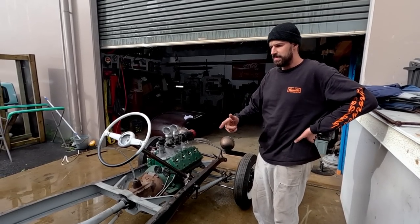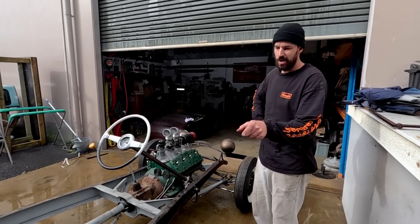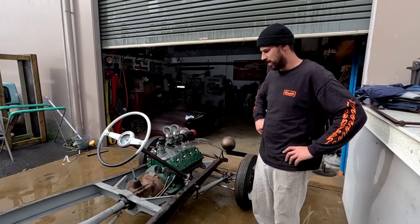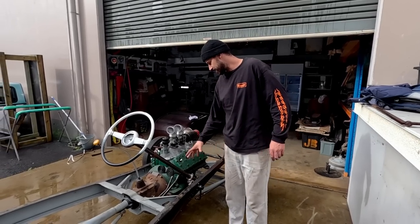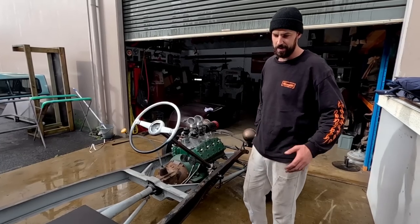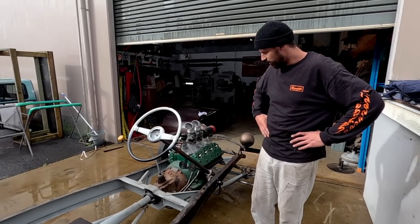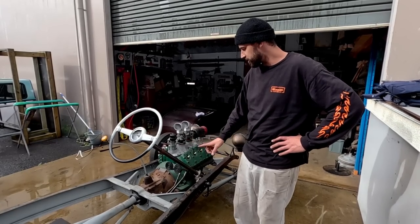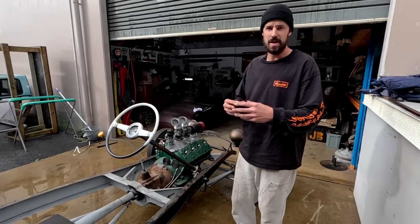Rear end still needs to be disassembled and gone through, making sure everything's all right in there. I did notice one of the keyways on the tapered shaft is a little bit worn out. So we'll go through that, but definitely pretty happy with how it's coming out. I feel like I overlooked that too much, just going through all the pedals and stuff, and those 33, 34 pedals really made easy work of it. So I still will machine those out. I'll explain how I'm going to do that and add those bronze bushings in to make sure everything's tight on that shaft.